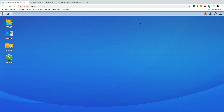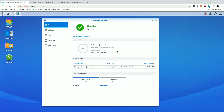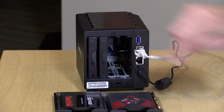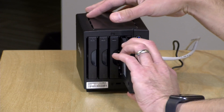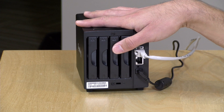You'll want to jump into the calculator and look at all the different drives you're planning to use and see how it might work in your particular situation. It's not hard, but it's something you really should plan ahead for. So let's see how this works in practice. We're going to go over to our control panel and go to the storage manager. Right now we've got an array of 215.4 gigabytes available. Remember, we have two 240-gigabyte drives, but one is protecting the other, so we only have the capacity of a single drive.